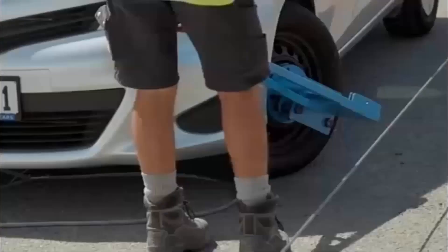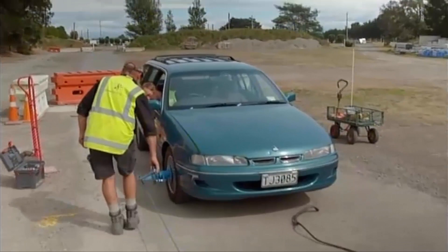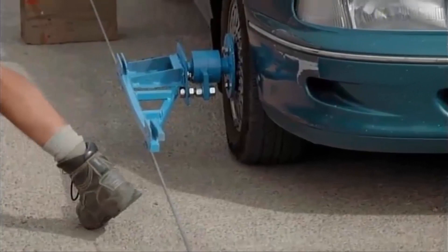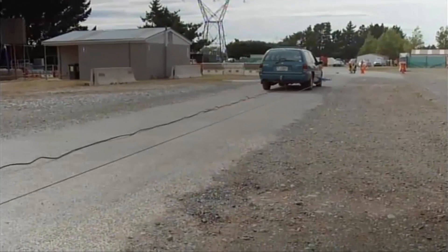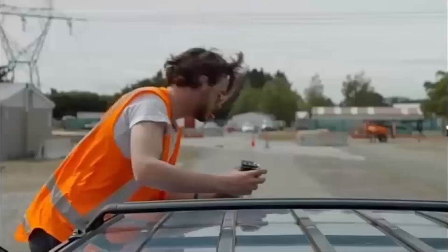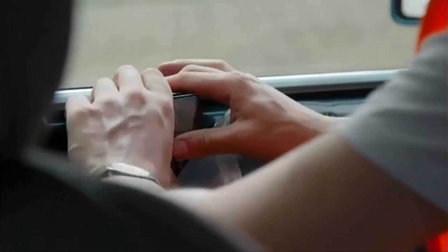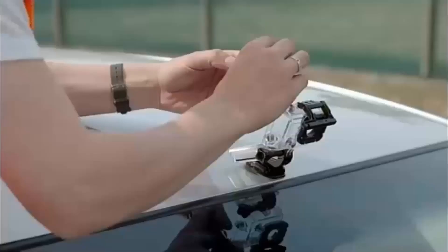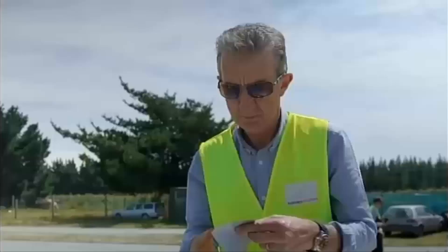The key to all of this is that the cars actually collide. It almost never happens, but the last thing we want is two unmanned, uncontrolled cars careering off in opposite directions at 70 km per hour. Like the ones we used on our trolleys, these wires will ensure that our cars collide, so they have to be tested and retested. Camera placement is crucial — we only get one go at this. We'll be employing 14 cameras at different angles, shooting at frame rates ranging from 25 to 5,000 frames per second.